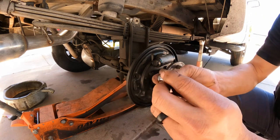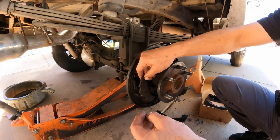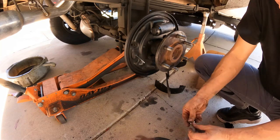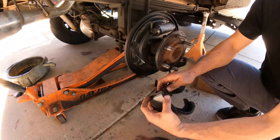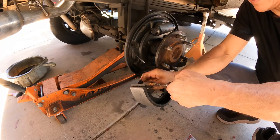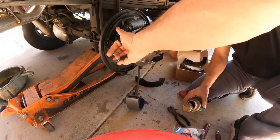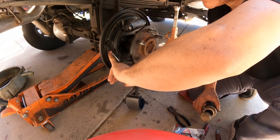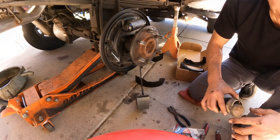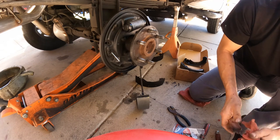This little spring washer goes here like this. Now this goes here. Once the washer is a little bit compressed it's a lot easier to slide things in — there you go, done. You don't want to put too much grease — if you overdo it, the heat sometimes can cause that grease to run and it's going to find its way into the shoe. So again, you don't want to put way too much of anything.